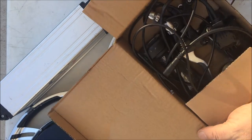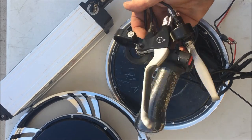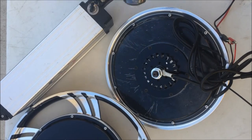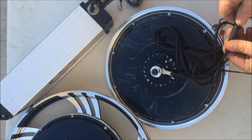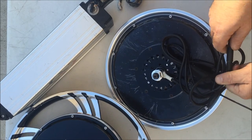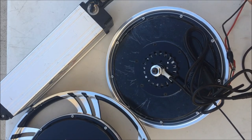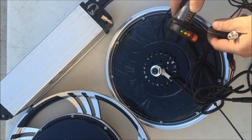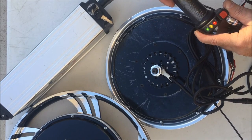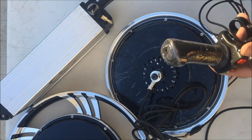With the kit you get this box of controls. Pull the controls out of the box — you can choose between a thumb throttle or a twist; this one has a twist. You just plug this into the motor here, like that. When you turn the battery on, you have lights on the throttle. And when you give the throttle a little twist, you can see the motor turns. That's everything you need to do to hook it up to make it go.